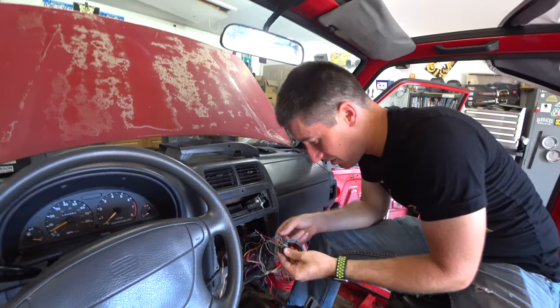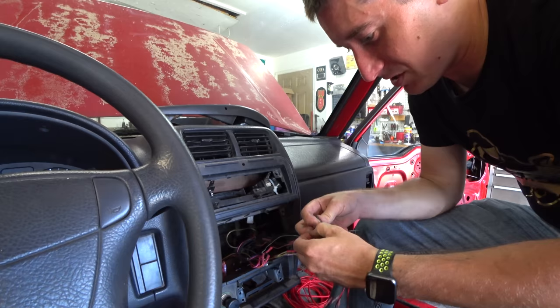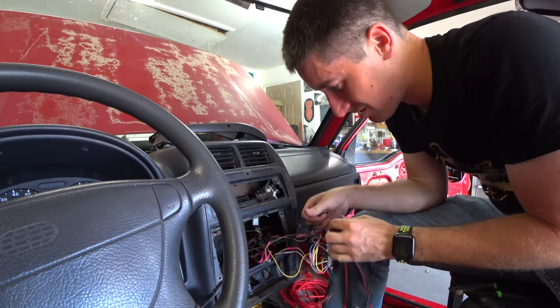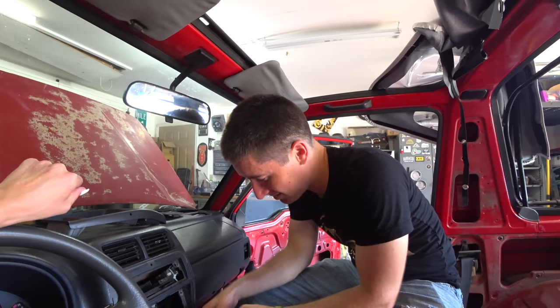It's right there. The remote wire is tied to the ignition switch wire. Everything in here is destroyed. Luckily, we can pull out the main power wire that's just shoved in a fuse because we've got brand new power wire right there. Oh, are these our little lights? These are the little lights that were under the dash, and they're all just so jankily wired. There's only like one strip of them under the passenger side that worked. This is just so sad. Let's get this junk power wire out of the fuse block now. It's really bad, guys. Probably one of the worst I've ever seen. So, we're getting it sorted though.